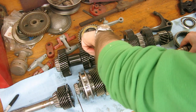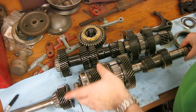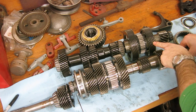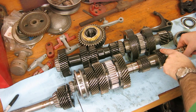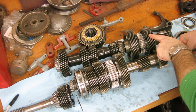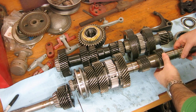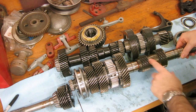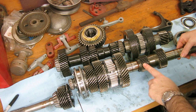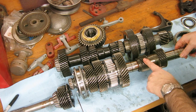So this is first gear, this is your second gear cluster, and this is your third gear cluster. We're going to skip fourth for a minute. Up here, this is your fifth gear cluster. You'll notice by now we've got a bigger gear driving a smaller gear, so for one revolution of our input shaft, we're going to have a few revolutions of the output shaft. And then this largest gear spinning this very smallest gear — this is your sixth gear. One revolution here, there are many revolutions here.